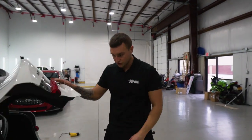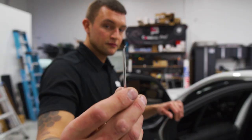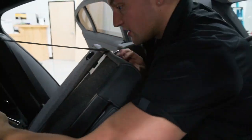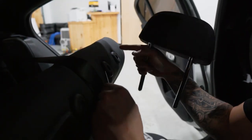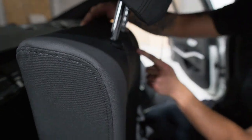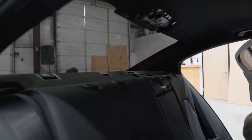First, go into the trunk — there are little latches there. Release both of the seats and go back inside. You're going to need a hook tool and a little pin tool. The center one comes out with two push tabs on the side, so take that out and get it out of the way. There's a little opening — push the hook tool in, push the button, and simultaneously push the tab on the side. Push the tab on the side, put pressure on it, use the hook tool to push the insert in, and the headrest will come right out. Now we can do the inside prep, slap the film on, and this car is done.